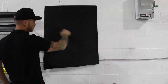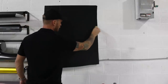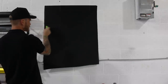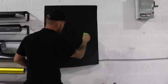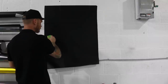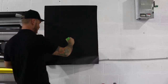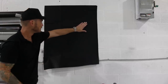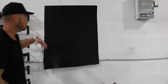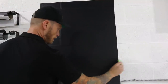This is not the highest tack film on the market but it is a higher tack film. I'm going to try and stay over top of the recesses and keep the film very flat — this makes it a lot easier to squeegee. We don't want to squeegee the film into the recesses because it'll start to bunch up and change the angle of the film. We want to bridge all those gaps and keep the film looking as smooth as possible.